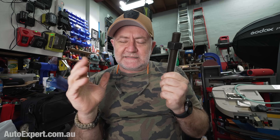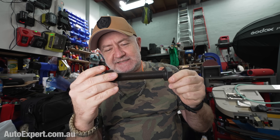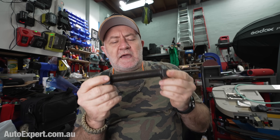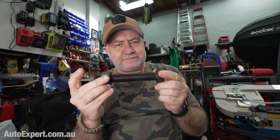And finally, the vexed question: are your nuts just going to get loose and fall off if you do any of that? A stud in good condition with a correctly tightened high tensile nut — they don't come loose. When the nut is in operation, there's a huge amount of clamping force and resistance, which you experience every time you have to crack one open to get the wheel off. As a thought experiment: with the standard wrench about a quarter of a metre long requiring 50 kilos of effort to undo — if you halve the length of the spanner, it needs 100 kilos. Take it to a quarter, it's 200 kilos. Shrink the wrench right down to a 10mm radius at the seating face — that's 25 times shorter, requiring 25 times more turning effort: about 1.25 tonnes.